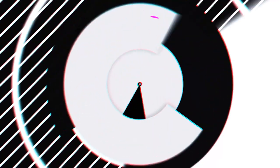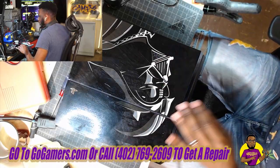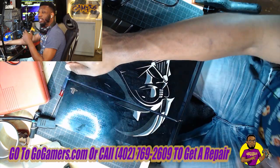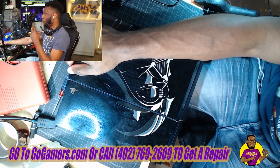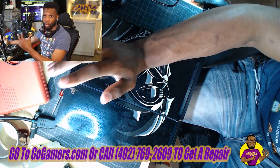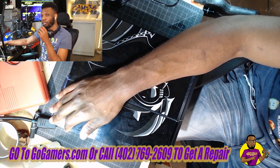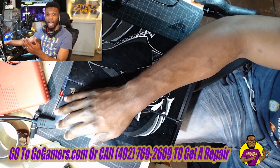We have a PS4 fat model console, the Darth Vader edition. It is actually very common that these things will always overheat or the fan will go loud and it just sounds like a jet engine. The way the fan maneuvers on these game consoles is it fluctuates to the temperature of your APU processor — if it's starting to get hot, it'll turn up high.